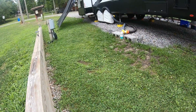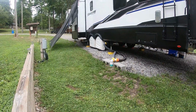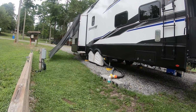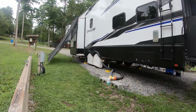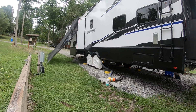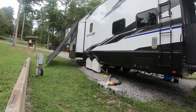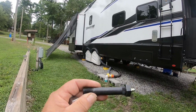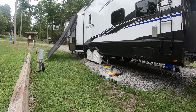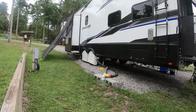These are not that easy to replace without trying to do both springs at the same time. I did one at the same time, and it was like, oops, how do I get the spring to pull back to the hole? And it took some maneuvering, some 2x4s, a pry bar, lifting and lowering, until I finally got the holes lined up where I could pop that bolt back in. The bushing was already in. The bushing goes into the spring. Okay? Bushing goes in the spring. Okay, enough about wet bolts.